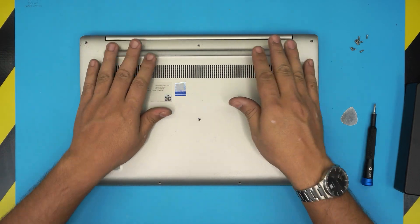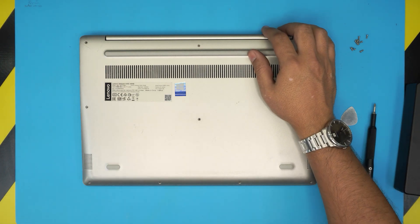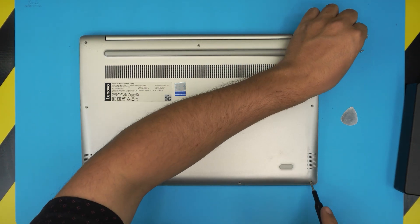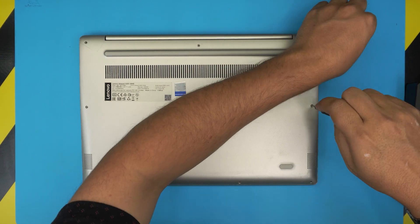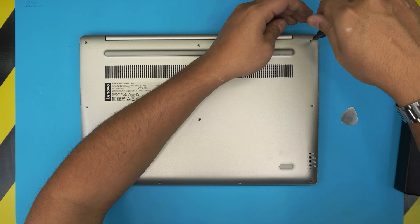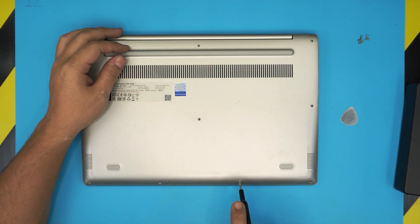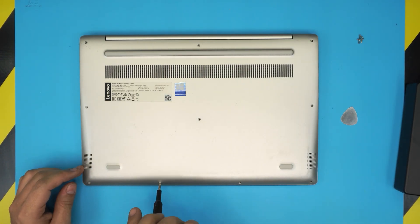One important thing to know: when you replace the battery and turn on the computer, it might blink for up to 10 seconds — that's normal. It's trying to detect the RAM and everything again. Every time you remove the battery, the first initial boot may show a black screen for a few seconds, so don't panic. Just leave it and you should get the boot screen. Now I'll finish putting the bottom screws in. Thanks for watching — leave any requests or questions in the comments and I'll see you in the next video.